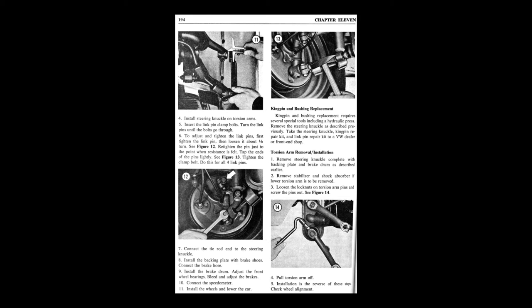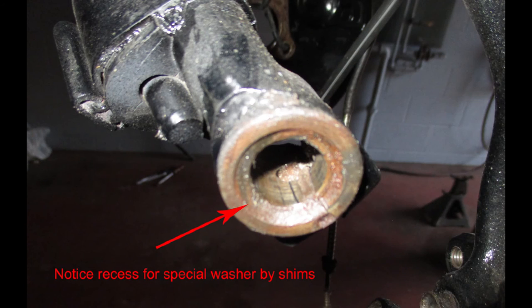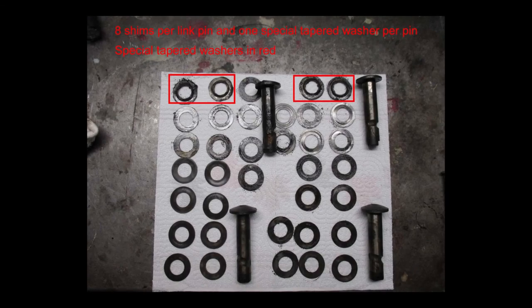Here is some vital information on your shims and how to measure to see if you have a bent torsion arm. I wasn't too concerned about accuracy this time because I'm in a hurry to get this car ready to drive to Farmington - if it handles better and the not-wanting-to-go-through-a-curve is fixed, I'll come back and be more precise. Now look at this spindle to be sure you've gotten all the shims out. If all the shims are gone, you're going to see this grease groove - if it's smooth, you've got a shim in there, remove it. As the book says, you should have eight shims total on each link pin. There's a special shim that goes at the very last on the link pin where it bolts up to the torsion bar - make sure you have that special washer, shown here in red at the top, in the right place. Critical.